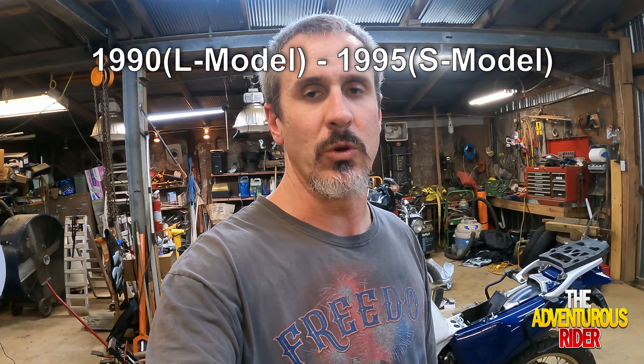In today's video, we're going to be working on the headlights for the Africa Twin. I'm not sure why, but when Honda developed the '93 model — and I think some other years too — they have it set up so the motorcycle headlights only have one dim light, even though it's a dual system. There's a slot in the headlight plug for an additional dim light, and even the bulb has both filaments, but a rule or regulation in Germany at the time said it wasn't going to have a secondary dim light. So I'm going to fix that, and I'm also going to be changing from incandescent bulbs to LED bulbs so I can see a little better at night.